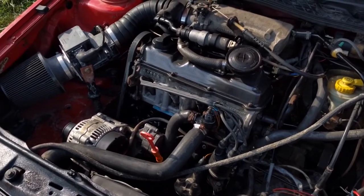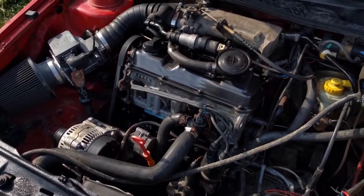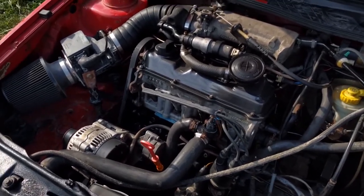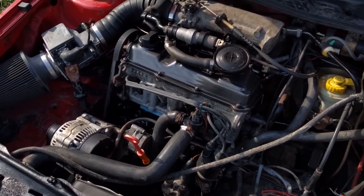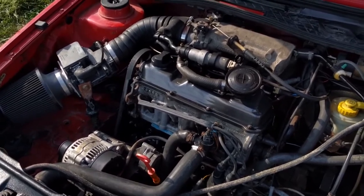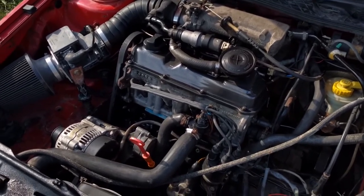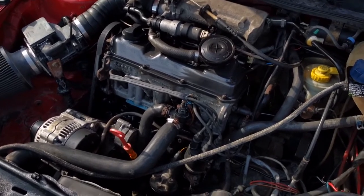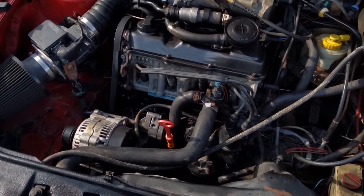The little thing did pretty good for being a junkyard motor with no more money in it than a head gasket. I even reused the old studs, which is a big no-no on these engines. You always put new studs in. But it lasted 3 years. And then finally, the number three cylinder had a little too much heat. It popped a ring on the top of the piston, which blew the top of the piston off. And it pretty well chewed up the block and beat the bottom of the head to death. The piston's got a hole in it, so that motor's dead. But this one was in the process of being rebuilt in my basement, and so I just had a reason to finish it a little bit quicker.